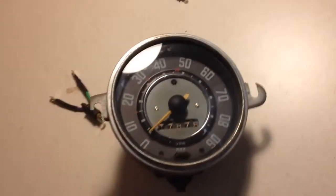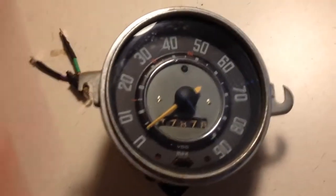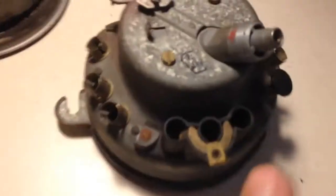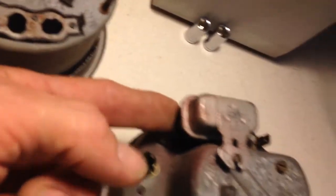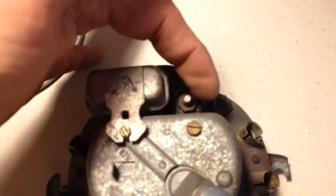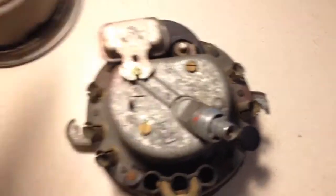Now, if for some reason you have an old speedometer and you wanted to upgrade to one that has a fuel gauge in it, and you don't have the wiring because it only gave you enough wires for the old setup, it's pretty simple. All you really need to do is track down one of those little jumpers and make a double jump so that not only can you plug the coil wire in there, you can also plug another short wire that comes off that and feeds around to plug into the back of that one. That way, when you turn your key on, you'll be giving juice to the sending unit. Then all you need to do is run a short wire from this post to your fuel tank sending unit, and just ground the sending unit from a nearby ground — so maybe you have to run two wires to it. But that's basically the breakdown as far as plugging up a Volkswagen speedometer in a dune buggy goes.